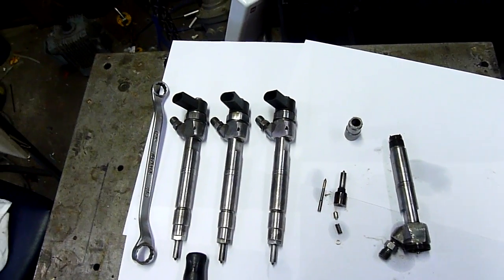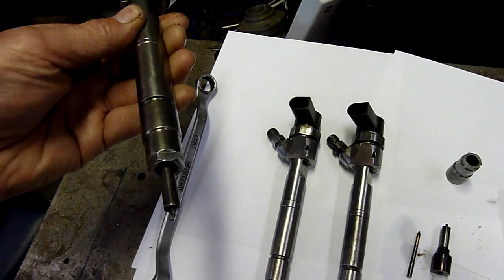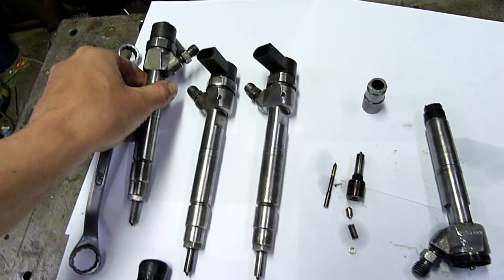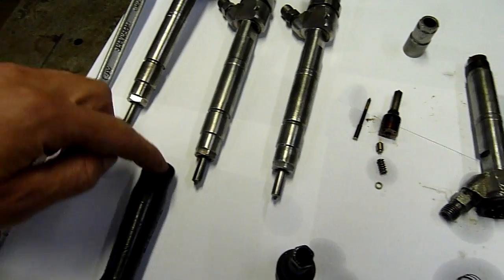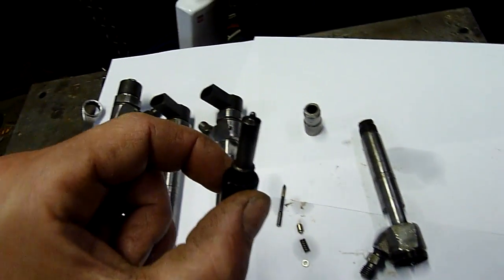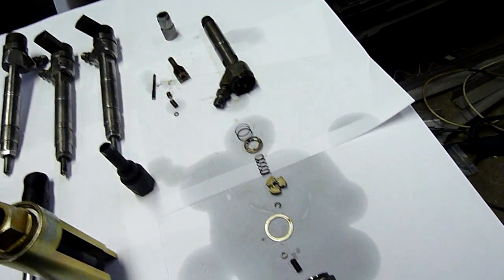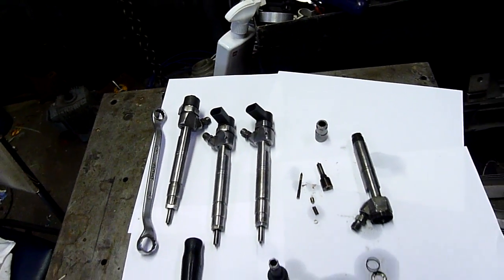So that's today's little rambly injector video. These ones are pretty good — if they'd come to me capped I'd probably put them in the car, but I want to get that fitting all cleaned out and everything, so I'll just hand them off to the shop. The tips don't appear to have been wire-wheeled — they've been cleaned down with a rag but they haven't been hit with a wire brush, thankfully. From what I could see up close, they haven't done the sinful thing of actually wire-wheeling the very tip, which would be a very bad thing. I'll have a look at them under the scope — if they have wire-wheeled the tips and wrecked the little holes in the tips, I might even consider sending them back. But I don't think that's the case. Anyway, that's what the microscope will tell me. Thanks for watching.